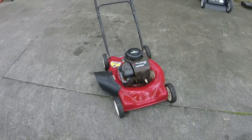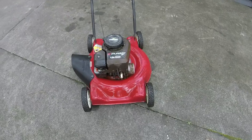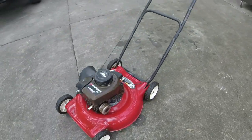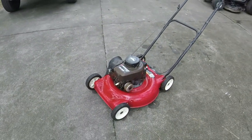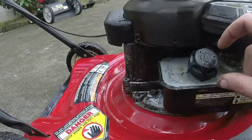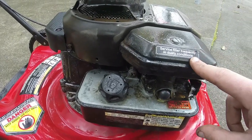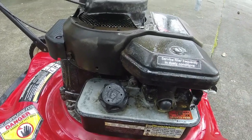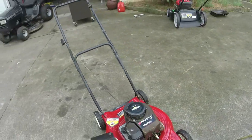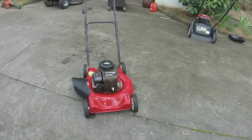Here is the end result of this Murray 3.5 Classic. A nice little bath helps it out a lot. This one just needed the gas tank mount fixed so it will be firm — and it is. Also: primer bulb, air filter, carb diaphragm, sharpened blade, new oil. All about an hour to an hour and 15 minutes worth of work, granted with the complications I had.